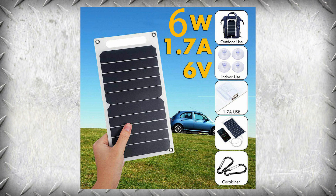That's your little charging-modern-mobile-devices 101. Figured I'd throw that in because it applies more and more as the years go on, especially to people who bought a phone in the last two years. Whether it's OnePlus Dash, Warp Charge, Motorola Rapid Charging, Turbo Power, MediaTek Pump Express, or Apple's Lightning 18-watt — all different standards, all different fast charging voltages. At the end of the day, every device I've ever seen will just resort to taking two amps over five volts, which is 10 watts — that's the backup plan when it can't fast charge.